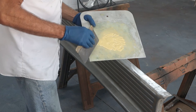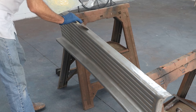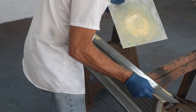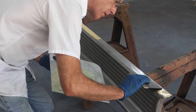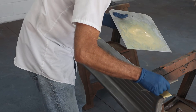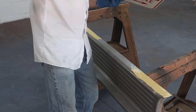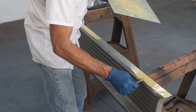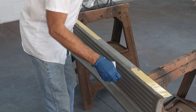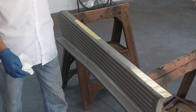Since these are so thin, we're going to be using some glazing putty on them. Just a little bit — super thin. This material is okay up to an eighth of an inch and we're nowhere near an eighth of an inch thick in these repairs. I'll scrape some of this out of this little lip right here because I don't want to have to sand it out of there. This stuff is pretty runny — I'll grab a paper towel and wipe that out. If you get body filler down into a groove or something you don't want to try to sand out, grab a paper towel, get a little solvent on there — a little lacquer thinner — and just wipe it right out of there.